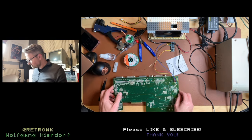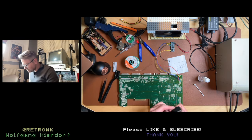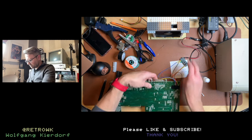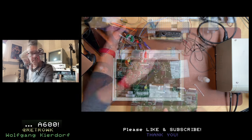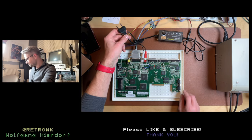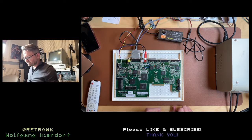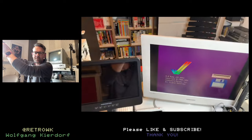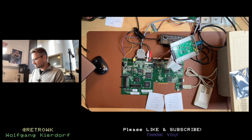Let's clean this up and test if the Amiga still works. I put some electrical tape so it doesn't short anything, and a little strain relief. So that is our A600 powered by a Pico PSU. The Amiga is put into the top cover of this IKEA Lego box - let's see what happens. 12 volts in... and the Amiga springs to life. Still good - nice!